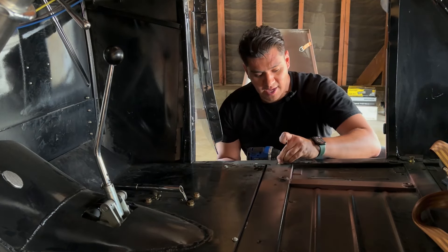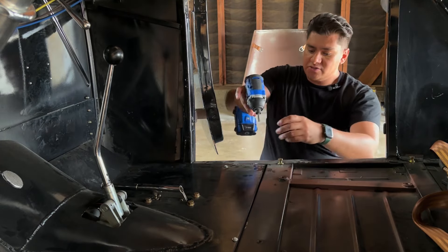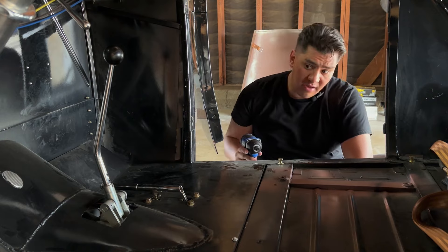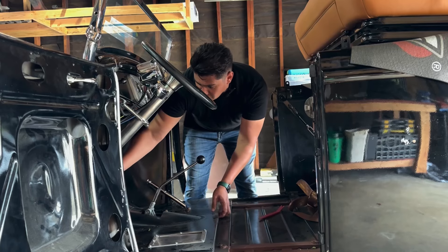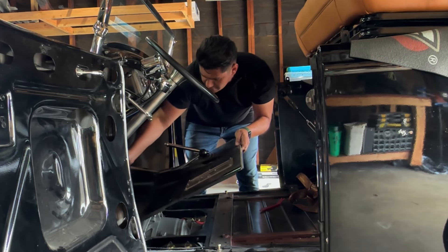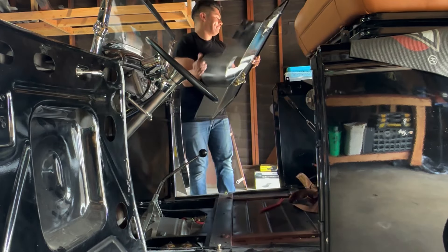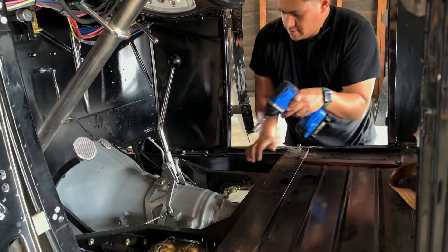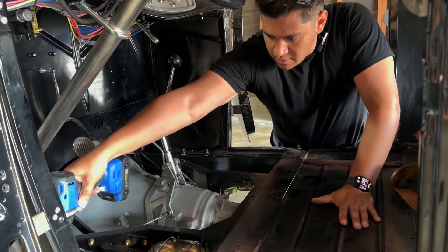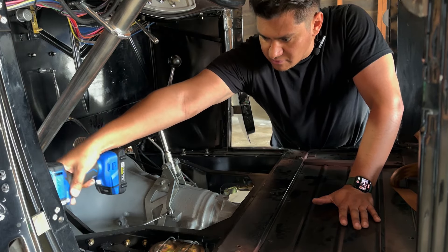Notice that I said loose — don't take them out all the way. Leave them somewhat threaded in; it's going to make your life easier when it comes to inserting shims. I need to remove the floor by removing these screws, disconnecting my emergency brake and my dimmer switch. I already popped this floor out, now it's just a matter of maneuvering it out. Last four bolts — again, just loosening them enough to be able to lift the body and start removing the shims.